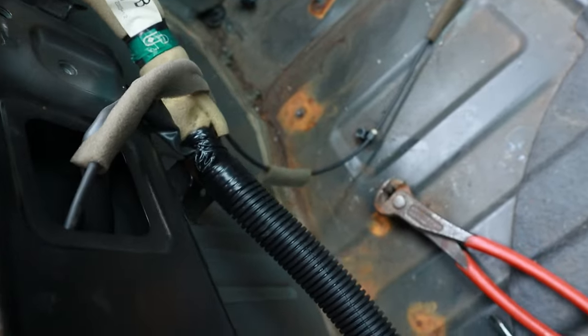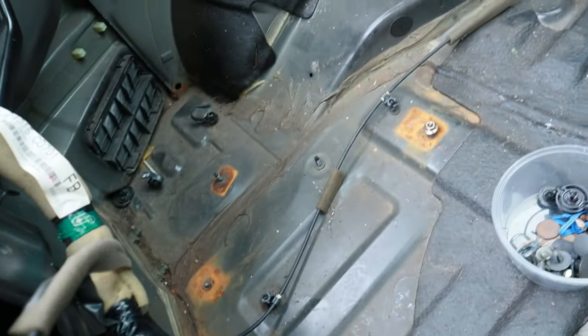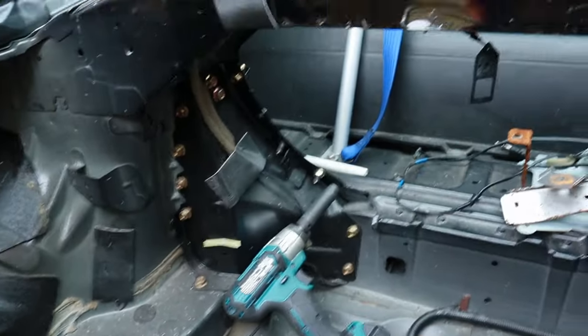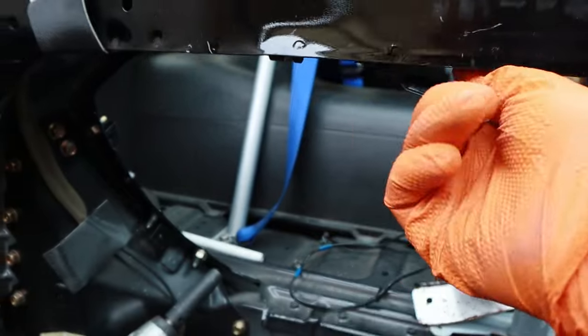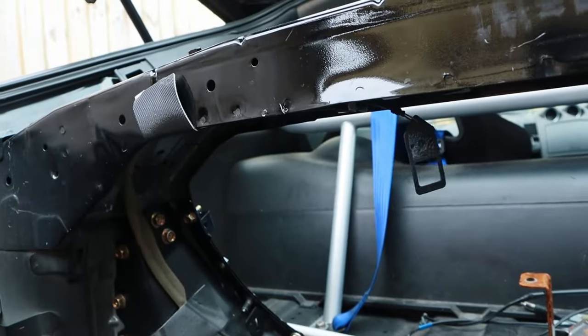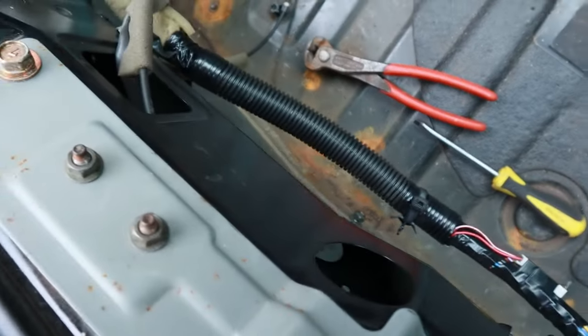You'll see. Interesting fact. I was like, it's got an electric boot popper, but there's a cable pulley system in it. I'm like, where does that cable go? So I've been looking around front. And it turns out, if you go underneath this bar here, there's a little pulley here. Emergency boot popper. I thought that was pretty good. So it basically means I can take that cable out as well. I don't need electronic assistance because the battery always dies anyway. I need to be able to open it manually.